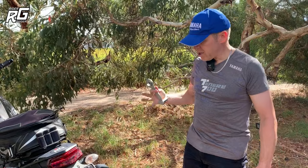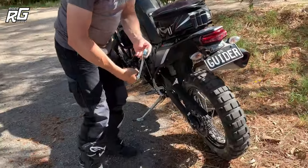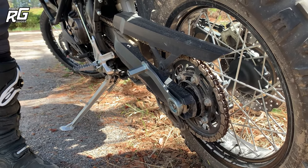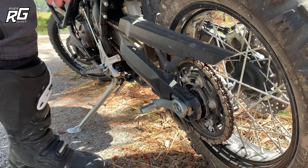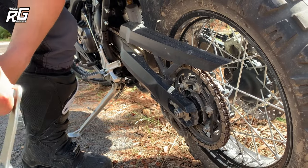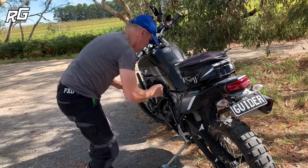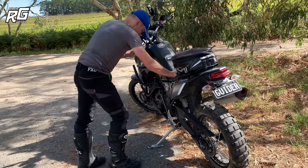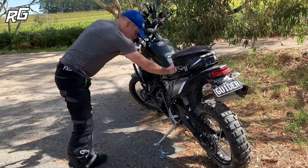I'm going to loosen the back wheel in situ with the Rally Raid tool. I can get a foot on it — it just slightly touches the swinging arm but I can probably get a foot on that and get a little bit of leverage. That's it, doesn't need a lot — and I've got it loose. One turn is all it needs, just slack enough to work on the bike. If you're on soft ground you can use the footpeg against it as a firm surface.